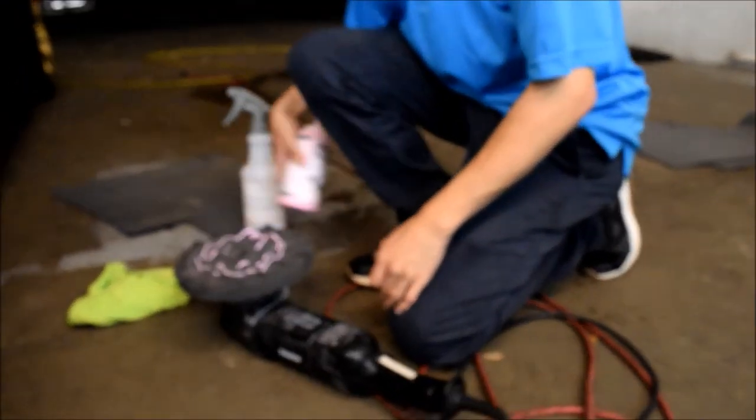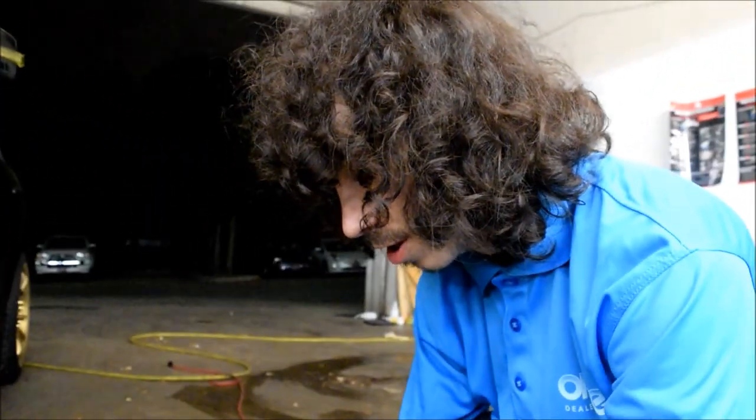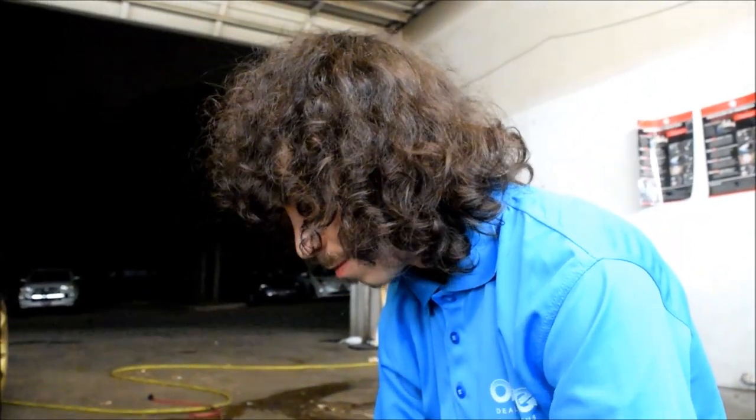So Dakota will see what he can do with detailing. Detailing can help to a certain extent, just for the surface scratches. But if it's deeper than the thumbnail — if you put your nail over it and feel it catch in the paint — then you know it's pretty deep. So right now he's going to get to buffing it out using one of these electric buffers. It's called an orbital polisher. There are buffers and polishers, and this one instead of spinning in a circle, it just vibrates in place. The reason it does that is because it has less of a chance of burning the paint, so it's a lot better to use.